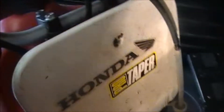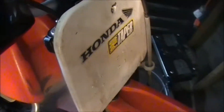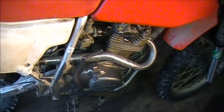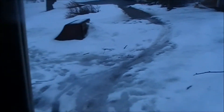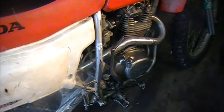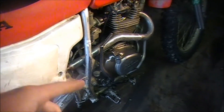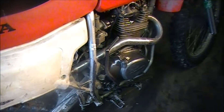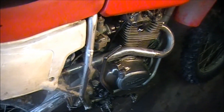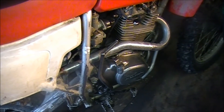Put a Pro Taper sticker on there. I worked hard to get this thing working again — I knew eventually I would get it back to running. There's still snow down but I rode it up and down the road a little bit and the clutch works perfectly fine. It only needed the little star nut wheel inside on that cover bracket, so I really didn't need to split the case at all.